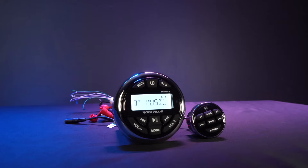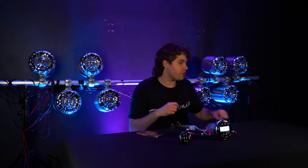To connect your smartphone or tablet to the receiver, set your receiver to Bluetooth mode. You'll see it says 'BT music' and while it's flashing it means it's unpaired. Go into the Bluetooth settings of your smartphone or tablet, search for the device that reads RGHR2, click on it to pair, and once your receiver reads 'connected' you'll know your devices are paired.